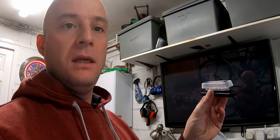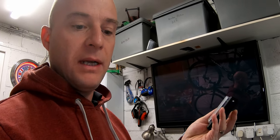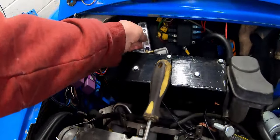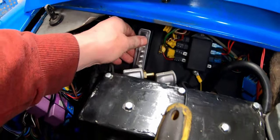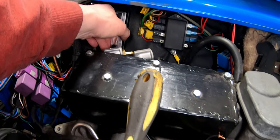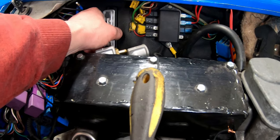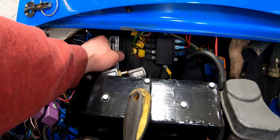It's been quite a busy weekend. I've got this little buzz bar for 12 volt feed, because I've got a few things I need to put a permanent 12 volt to - relays and such like. I'm going to mount this on the bulkhead just about there, so I can run a 12 volt feed to it from the battery and then go off to things like the radiator fan and wherever else. I'll most likely use inline fuses with those things I'm feeding.